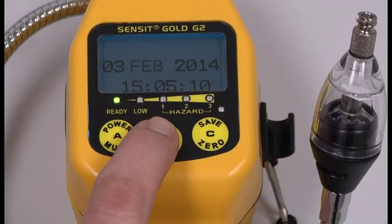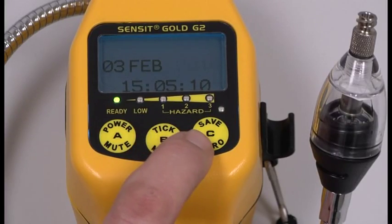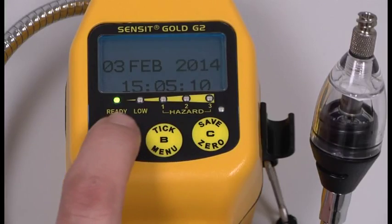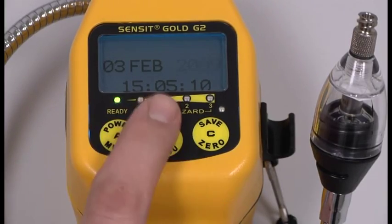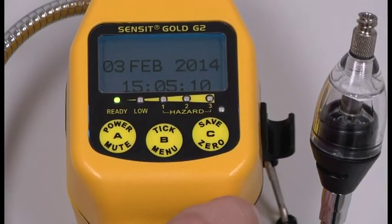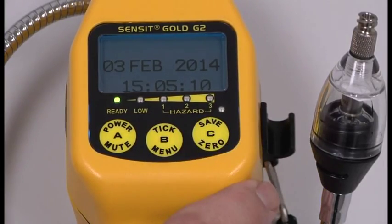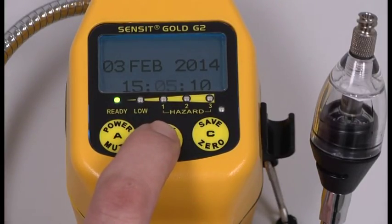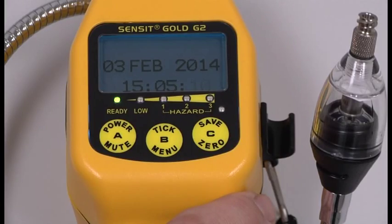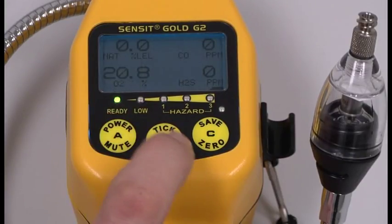The month will start to flash. If the month is incorrect, press and release the B button until you reach the desired month, then press C. The year will flash. If the year is past the current year, just press your A button with the year flashing and it will default back to 2009. Then press and release the B button until you get to the current year and press C. This will be your hours — press and release B to adjust. Press C and your minutes will start to flash; use B to set those, and C for the seconds. It's not very critical where the seconds are, so once everything is set and correct, press A twice to exit back to the work display.